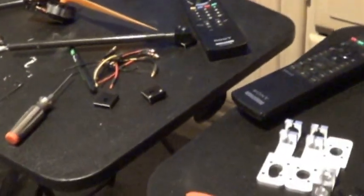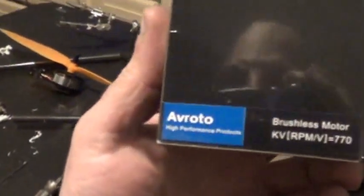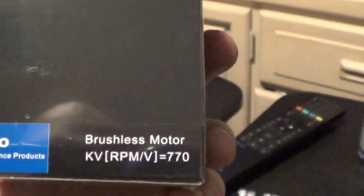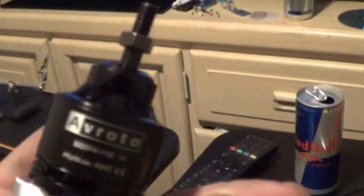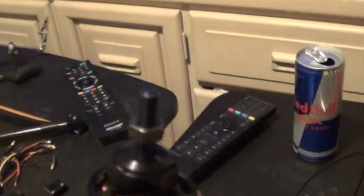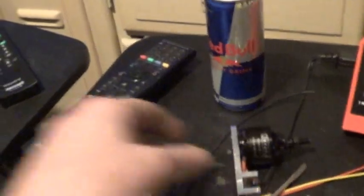There was no way I was going to sell it like this, so I ended up buying new motors. I think they're Japanese-made brushless motors, 770kv, and they can handle up to 3 to 4S. They're very powerful motors. Here they are right here - 2814 motors. You will find these on multi-copter websites. They're very good. I heard they've got a 6 millimeter shaft.